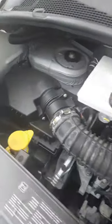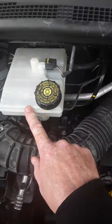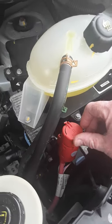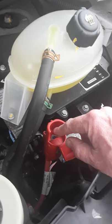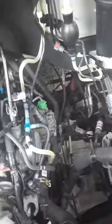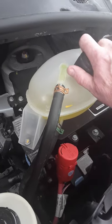We're just here at your engine compartment. The only things you're really going to have to look at are: your window wash, your brake fluid over here, your dipstick is down here, your oil filler cap, and your power steering fluid. If you ever have to jump start the van, you can see this wee red thing here — flip that open and you can put your positive lead from your jump leads onto here. Put your negative on the frame of the engine somewhere. The battery isn't right on the floor inside, and that's your water for your engine coolant.